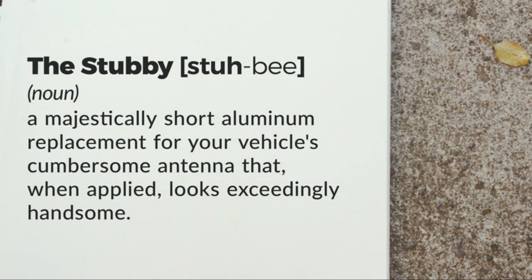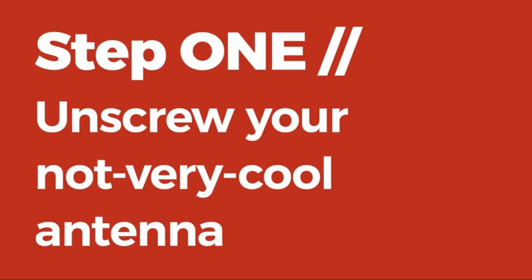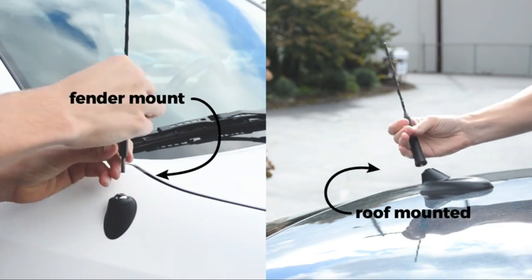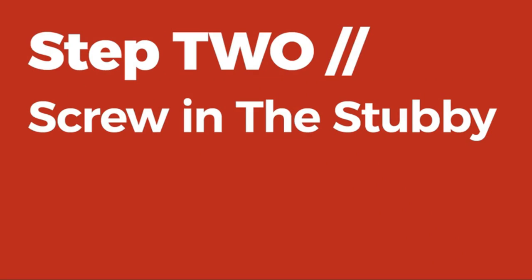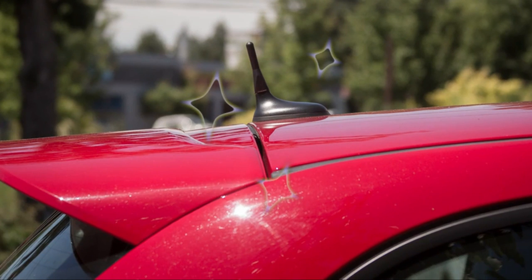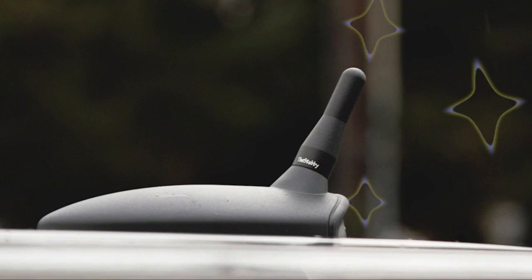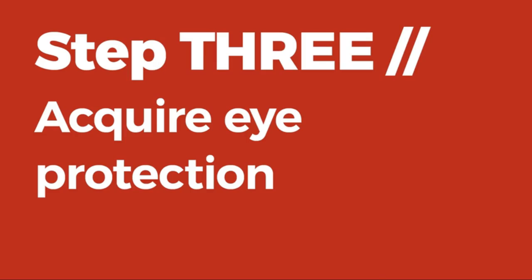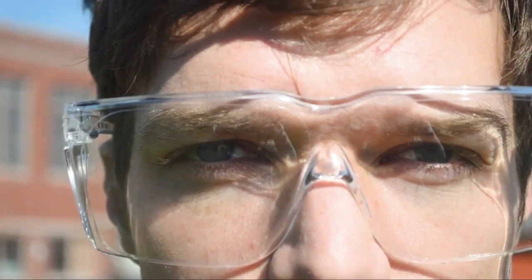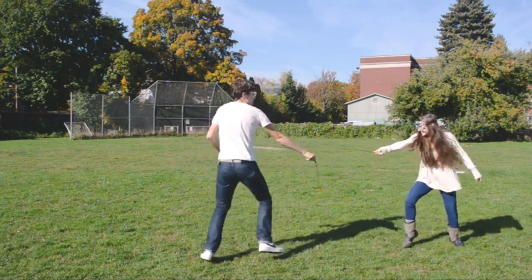The number four on the list is the Craven Speed stubby antenna compatible for the Raptor. After a few warnings about how hard it would be to get the OEM antenna off, I braced for the worst — the thing came out by hand. I noticed the OEM antenna had some threads showing and didn't fit right. This stubby antenna screwed right down flush with the base plate. I backed it out, put on some blue Loctite, and screwed it down firmly by hand.